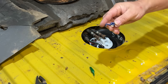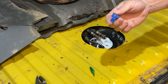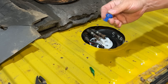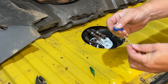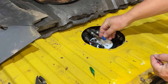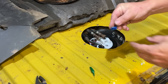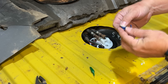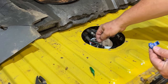I see these used on cars all the time and these are a temporary thing — don't be wiring your car up with these for something permanent. This is only for a temporary fix until I can diagnose the rest of the car. How it works is it lets you stick a wire in one end, and this end is open so you can slip it over the other wire, then push the blade down so it goes on both sides of the conductor and connects the two wires without damaging the insulation.